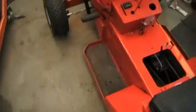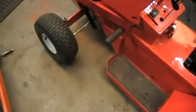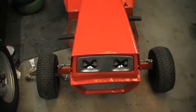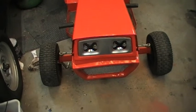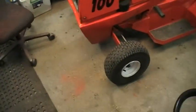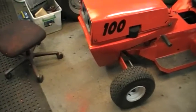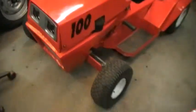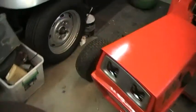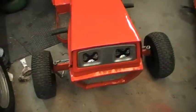I was happy with most everything on it. My tacho, a piece of rubbish off eBay, didn't work. What else did I do? I'm not sure if I said, but I made a new front end for it, 100mm wider each side. That helped a lot. I would have rolled it last year if I was going as fast as I was this year. Of course, when I sectioned the body and dropped everything down, nothing fit back in, so I had to make new steering arms. Everything was fairly rushed in the end.